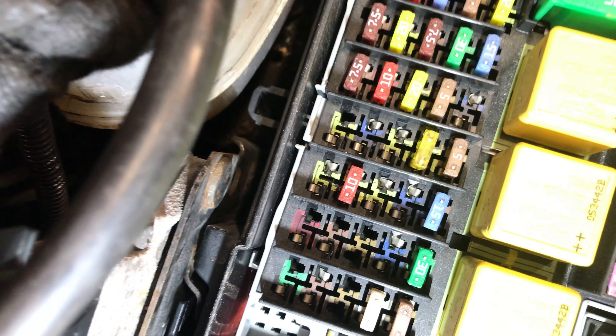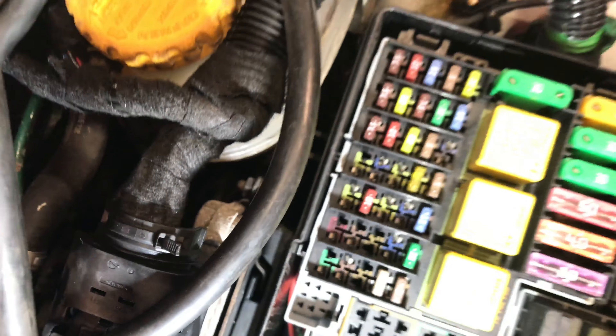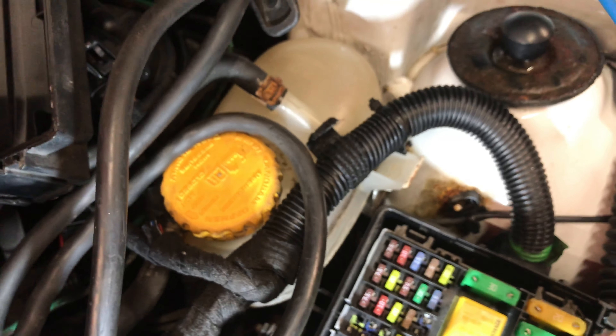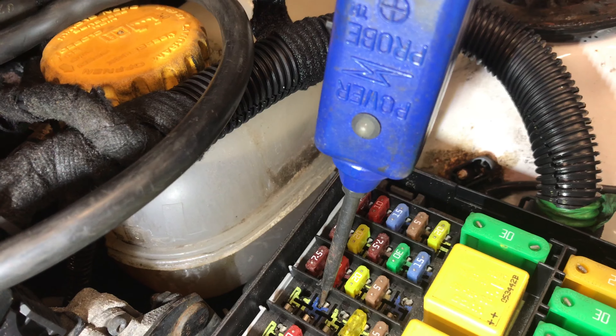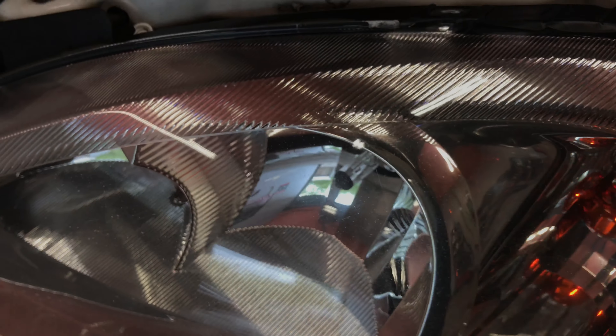So I decided to have a look in the fuse box, and when I looked I said look at this — there's some fuses missing. So all I done was took my power probe. See that — I'll take you down to this. I done that and look at that, that's an indicator circuit. So if I go to the other side of it, you can see I've got a constant power. So all I done was I fed that with power, and the next thing — voila — it started working again.